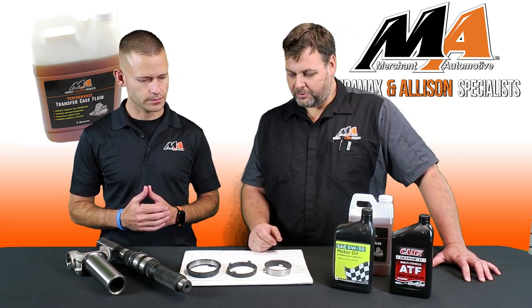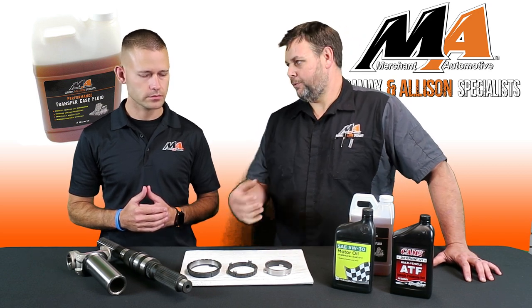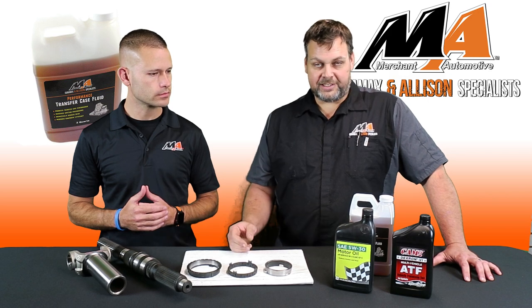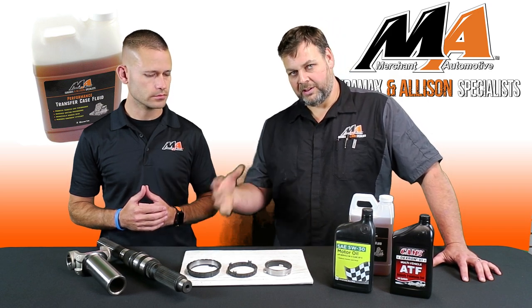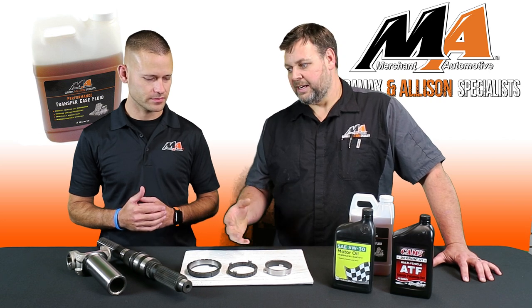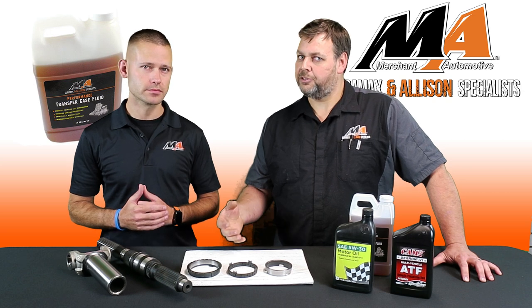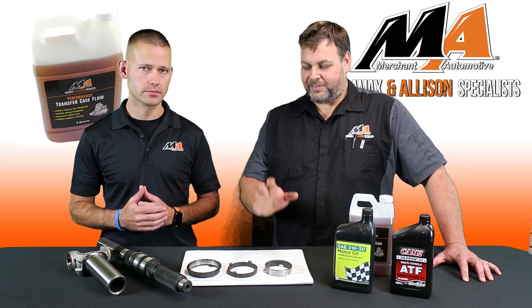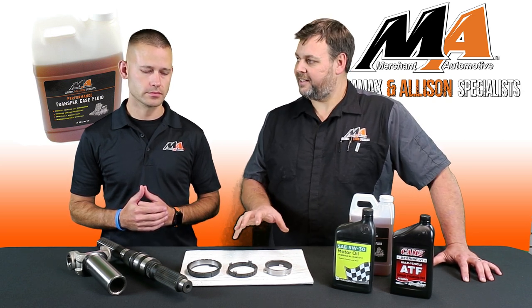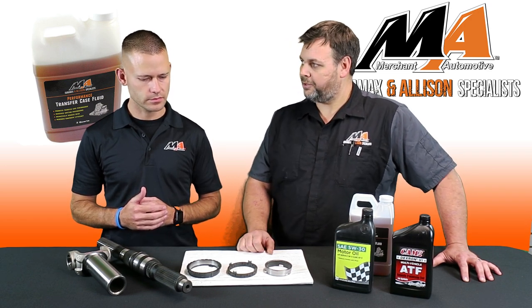If an engine holds 10 quarts, you're not going to put 12 in it because that's harmful. A transmission has a capacity. You overfill it, that's harmful. A transfer case is no different. It's designed to hold what it's designed to hold. Overfilling it doesn't do any good. If it seems to help something, well, maybe there's other issues going on. So really, 5W30 might work, but it's just not intended for this, and it's going to lead to other problems. So I would say stay away from engine oil.